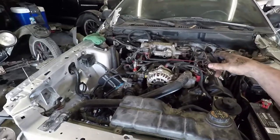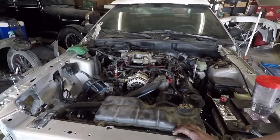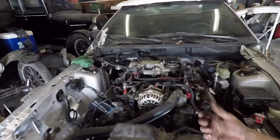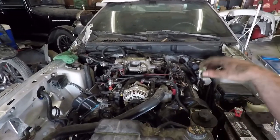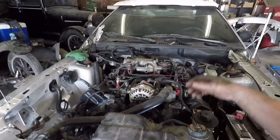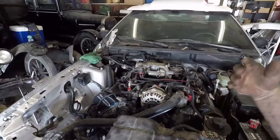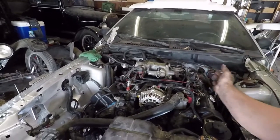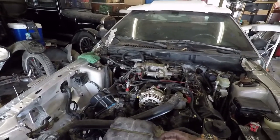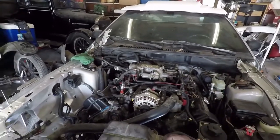You may or may not have noticed, but the EGR valve that I threw on the intake is not complete. As I mentioned previously, I am doing an EGR delete. There is a brass cap on the header blocking off the EGR port there. However, because I will be running stock for a couple weeks until my new intake setup gets here, I needed something to block off the EGR port on the throttle body. So we just pinched the tube, plugged it all in, and called it good.